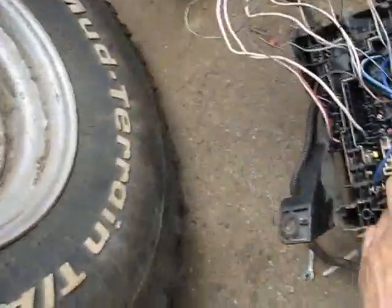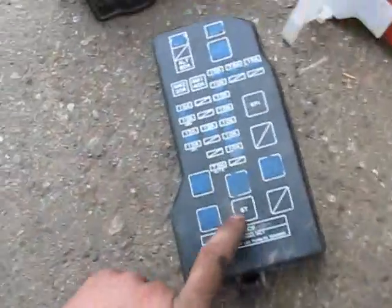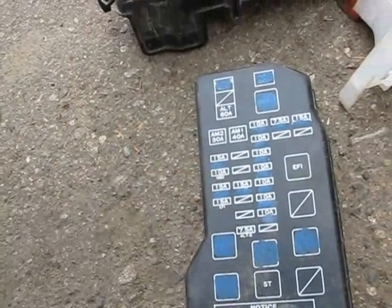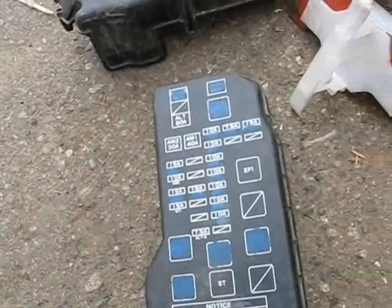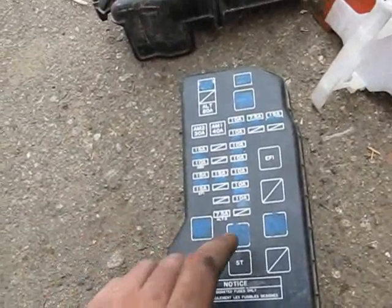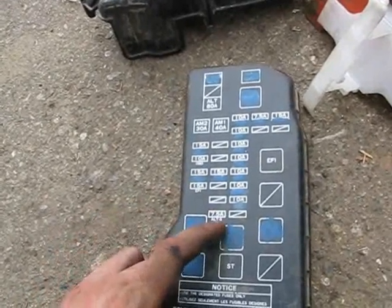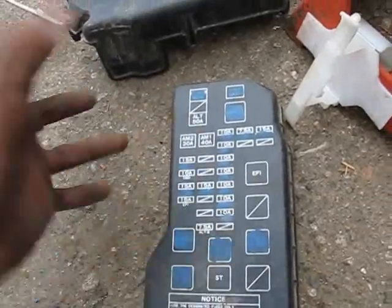So that means I eliminated both those other fuse boxes. When I put it into my 85, it didn't have a bunch of circuits, so I had to use this guy. I pulled all but maybe 4 wires or 4 things out of it. I'll show you guys what all I kept. I kept the starter relay, the EFI relay, the alternator fuse, EFI fuse, the OBD fuse, which I didn't even need, and then just the regular stuff. That's all I had. But I'm using the 3-liter EFI system, the 3-liter alternator, 3-liter starter, and everything else.